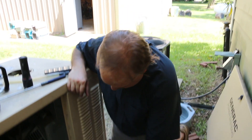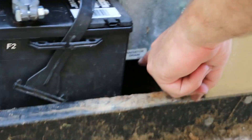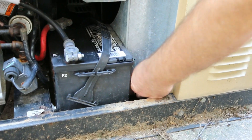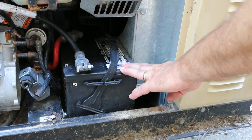The drain for the radiator can be accessed from the side door — the main door that you do all your maintenance from. There's a label down near the fan guard at the bottom that says radiator drain. You can actually access and do all the work you need to right here in this tight space, but it's a lot easier if you take the battery out and get it out of the way.